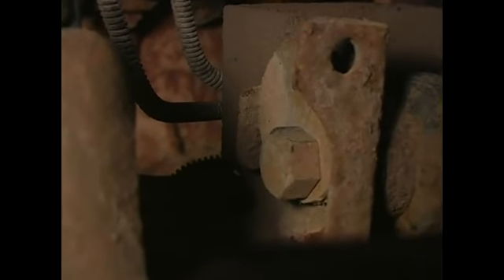What we're going to do, to put it right back to the way it was from factory, is take a marker and we're going to mark the bolt, mark the top of it, and mark a permanent part on the vehicle — the control arm mounting surface. When we reinstall it, we're going to line our two marks back up and that will ensure that our alignment integrity is maintained and that you don't have to go see your service mechanic and pay for a front end alignment.